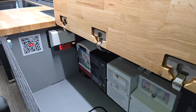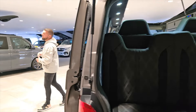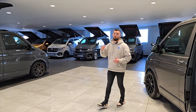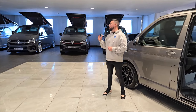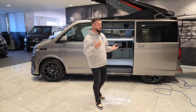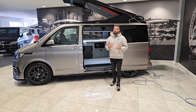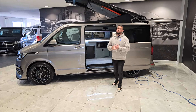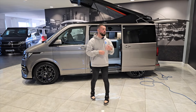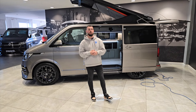We do this in the showroom — we cycle the vans on a daily basis, working our way through plugging in multiple vans and making sure each has had a good charge. Five to six hours is the minimum recommended time I would always advise, but it's up to you how long you want to plug them in. Once a month is the recommended frequency — I wouldn't be plugging them in every couple of days, but I certainly would be doing it once a month and getting a decent amount of charge time in.